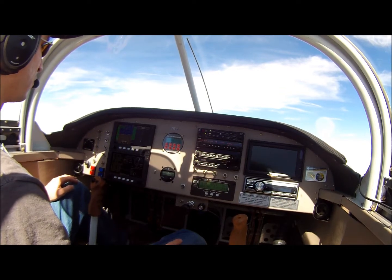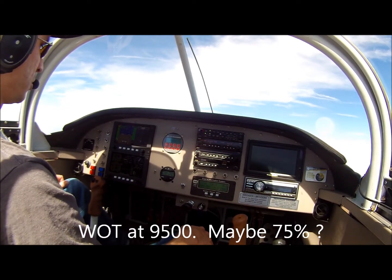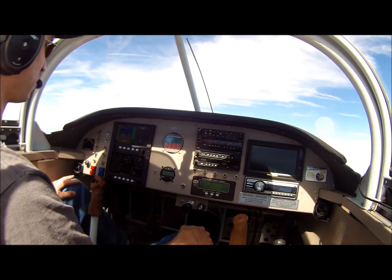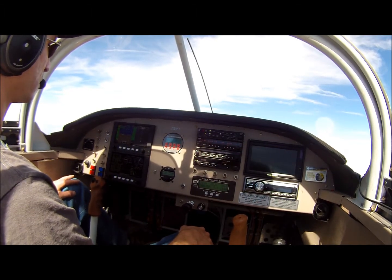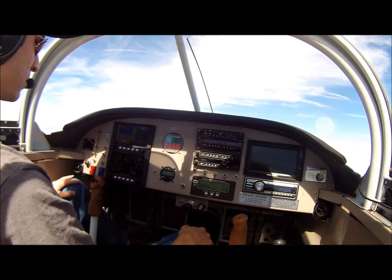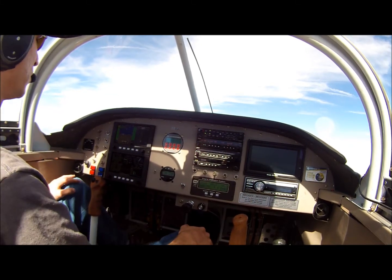This is 9,500 feet and 73 degrees Fahrenheit outside air temp. I've got it opened up a little bit more — showing 159 knots true airspeed at 9.8 to 9.9 gallons per hour, 2,510 prop RPM, still 73 degrees, still 9,500 feet. There's 160 knots just bumped up, 2,520 RPM, still 9.9 gallons per hour. That's a pretty decent performance for a fixed pitch RV — obviously the O-360s will go a little faster, but this will still get you somewhere just fine.